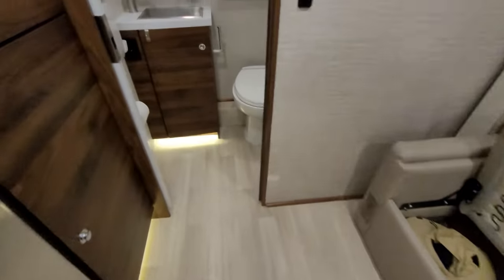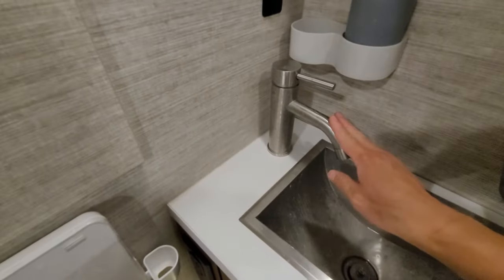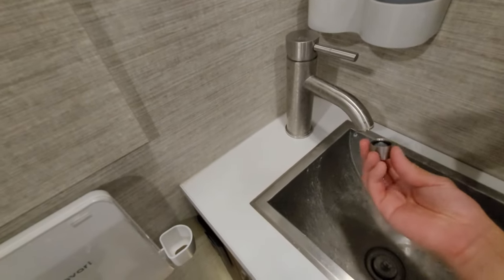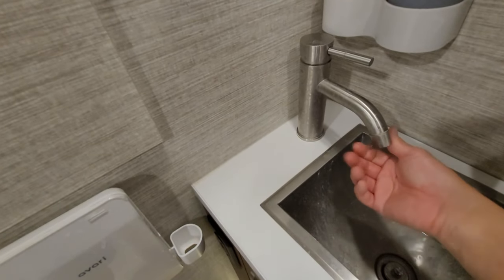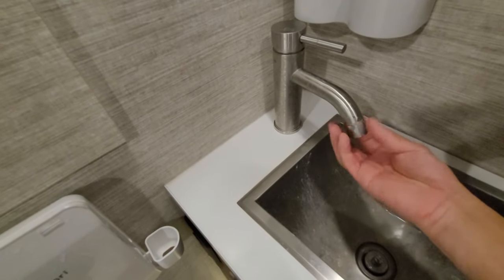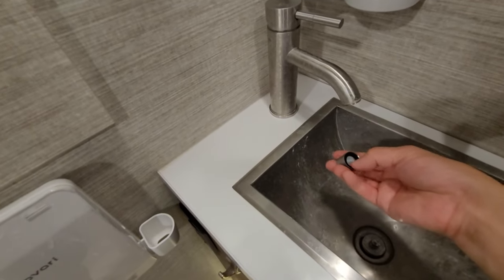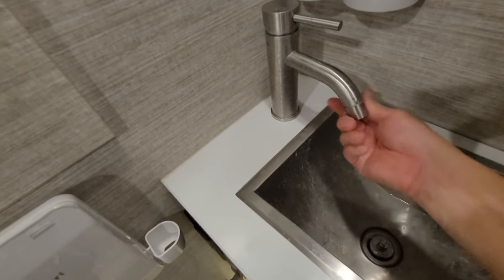Let's go into the bathroom. In the bathroom I have this faucet here. If you've watched my previous videos, I did a modification. My faucet has this little end that basically screws out — some faucets have that on the end and some do not. This one specifically, if you take it out, this is the aerator. You can just pop it in and out. I switched out this aerator to a low-flow aerator.